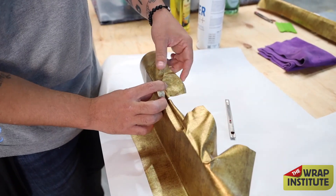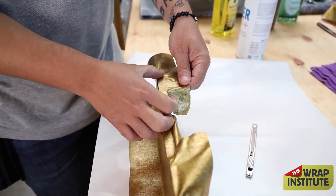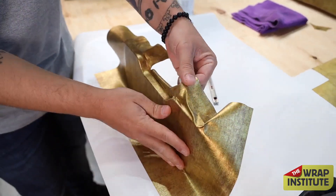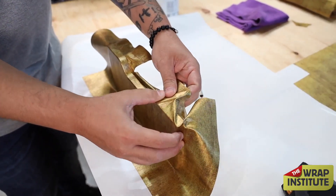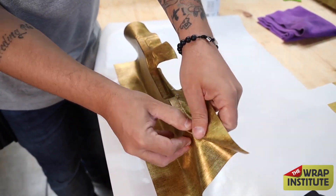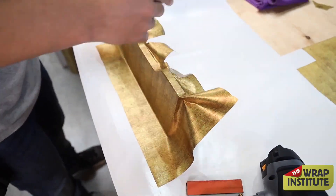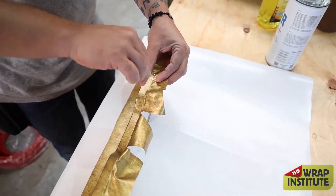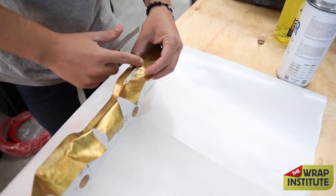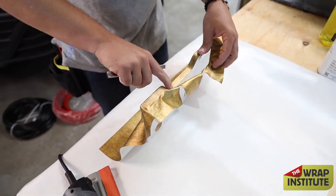He could make a relief cut and create an overlap or butt joint, but instead he stretches the film towards the back and uses a massage technique to really even out that tension. In combination with the fact that this surface has medium to high surface energy plus adhesive promoter, this will stay for the long term. He's wrapping this in one piece because it's not a sharp corner — it's rounded and feathers out — so he's making the right choice in terms of tension and long-term hold, which is what installers always have to balance.